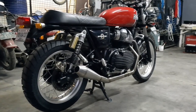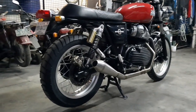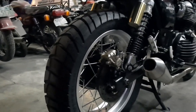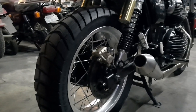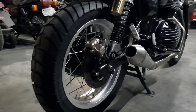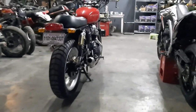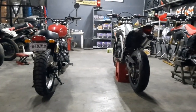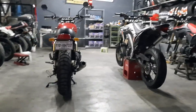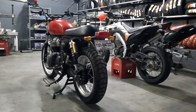The most challenging part of this build was the offsets of the rear wheel. As you can see, we're rolling on — I forget the exact name — but it is a 150/70-17 tire on a 4.25-wide rim with 36 spokes. I discussed the number of spokes, measurements, and so on in the previous video, so go check that out. Look at how wide and chunky that is compared to the CRF with a 140. In my opinion it looks way better — you could probably mistake it for a Triumph Scrambler.